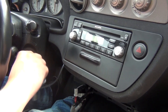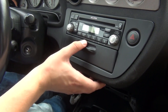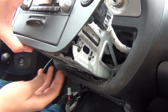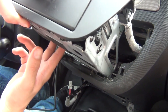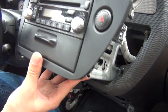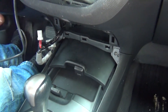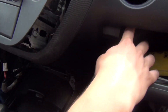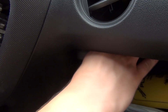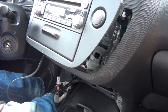After you've tested everything, you're gonna have to run the cables. You have two options on this car. Option one: run the cables into this compartment right here — for that you will have to remove the radio and drill a hole into this plastic compartment, so both cables come out of there, but you'd have to drive with this thing open. The other option is to hide the module at the back and run the cables into the glove box. The glove box is very open, and if you remove the radio you can meet your hands halfway — it's basically open space, so you don't have to drill anything. Just drop it in the glove box and lock the cables with the glove box.